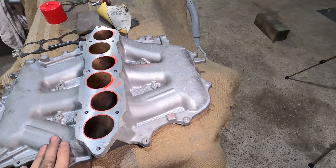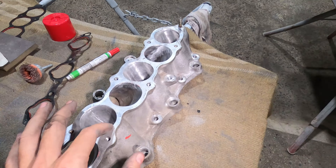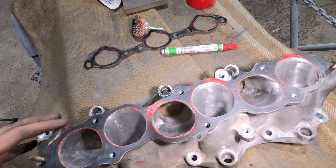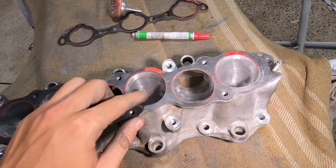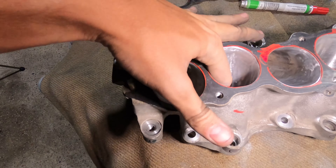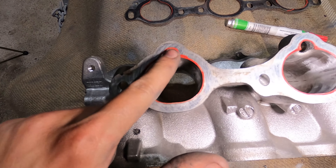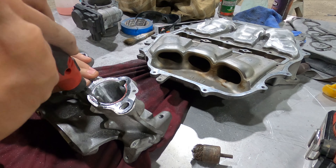On the lower plenum I'm going to do the same thing — marked out with pen. Here's the intake manifold finished, and then we'll move to the bottom side afterwards. You can see each of these is now smooth, all the cast marks taken out, all the pitting gone and rounded out on the top side. Next up we're moving to the bottom side of this intake manifold — you can see it's marked out, that's the area we need to remove material from.